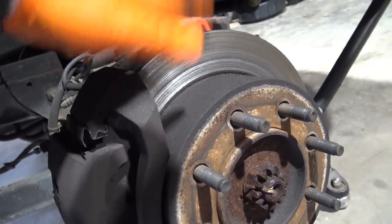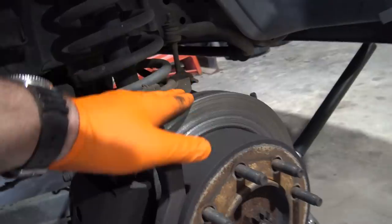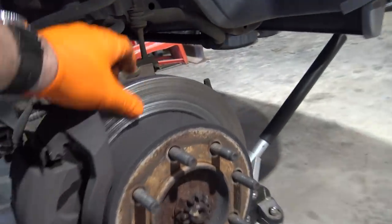Once I loosen the brake caliper, this should just slip right off. I'm probably looking at about $80 for the pair — that's my guess. Now we're into a job like this — do you go ahead and get drilled and slotted rotors, something a little better? We bought ceramic brakes so we wouldn't have the brake dust issue, but I had no idea it was gouging into that wheel that bad. I'm going to pop the brakes out, see if that rotor comes loose, and probably replace both front rotors. Never quite works out like you want it to sometimes.